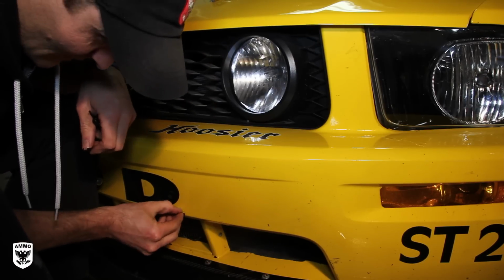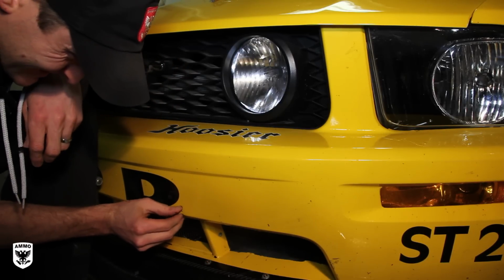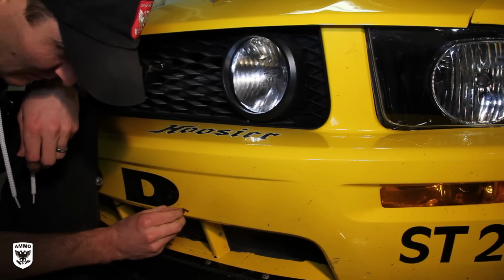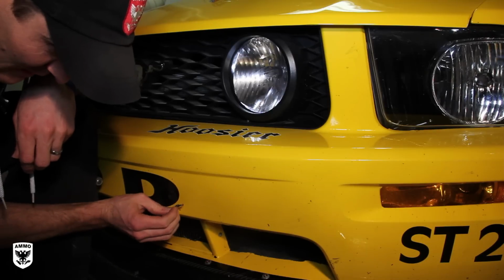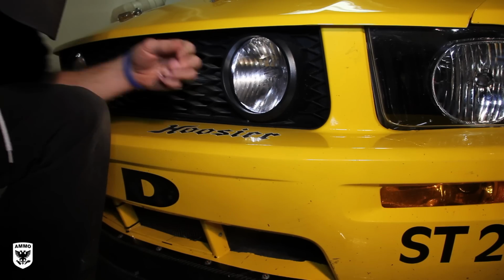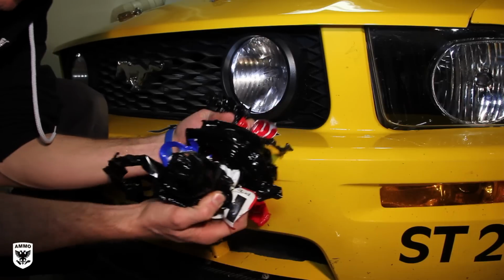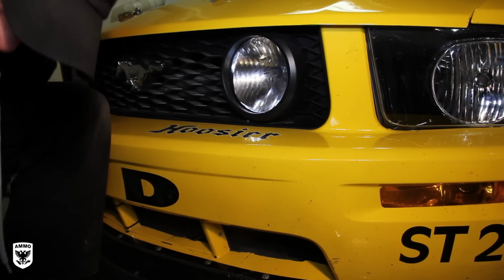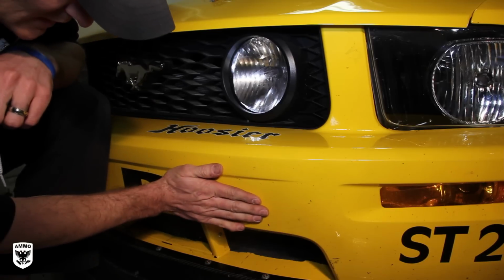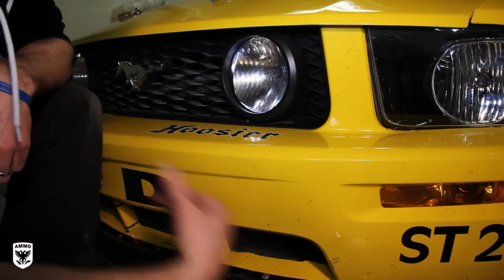I know that maybe looks a lot easier, but if you try to, see, this one's starting to dry. Look how hard that is to get off, just because it's cooled down. Look at that, that one little spot, and I just did that whole thing. So anyways, look at all these I've taken off already. So that's a big trick. Make sure you use a heat gun, but don't go too crazy. Yeah, see this? I can put my hand on here now. It's warm, but not crazy. I'm gonna do the same thing here and go around the rest of the car.